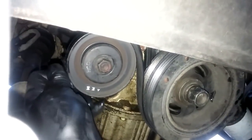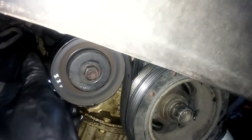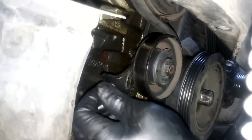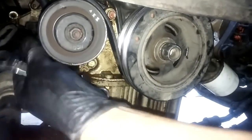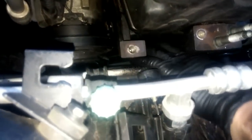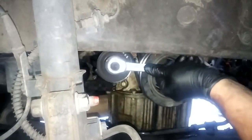There's a bolt behind here that applies tension to that pulley, which then puts tension on the belt. Just go to the top and check the feel of the amount of tension on the belt — it's still a little bit loose. Once the proper tension has been applied, then just tighten up this nut on the pulley.